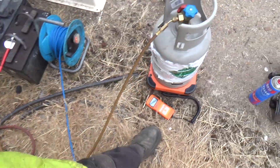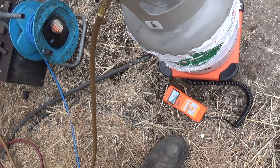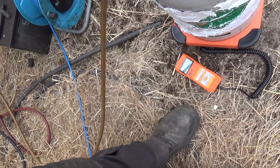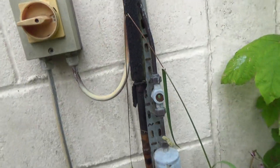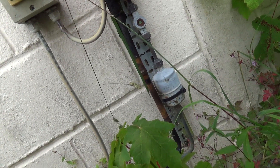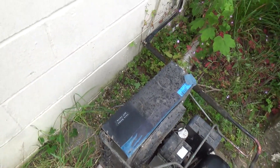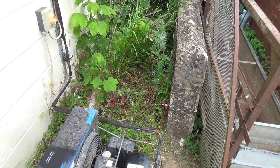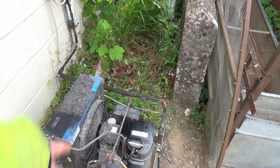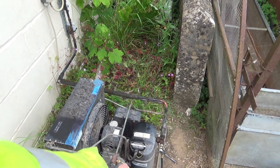You saw it seize up. We've sucked some oil and the Supco 88 into it, and it's been running for a good half hour while I've had a sandwich and been chatting on the phone. We've got to put some more gas in there - it said on there 2 kilos. We've got too much in there now, 35 grams over. A few bubbles in the sight glass still, might settle down. I'm hoping that it running is going to bring the oil back. I might pump it down and let the gas go again, because that might blast a bit more through - if we can get the oil level up in the compressor it might keep running.